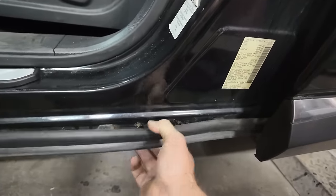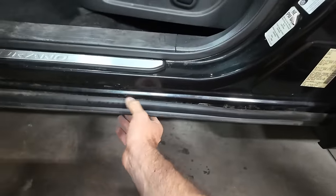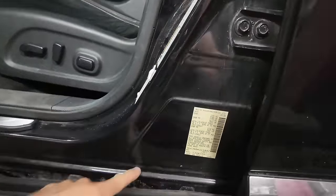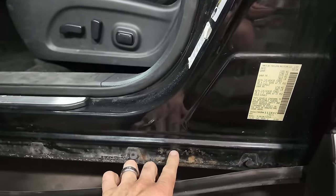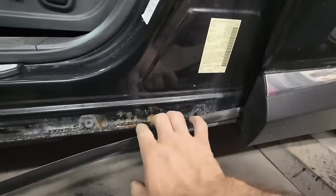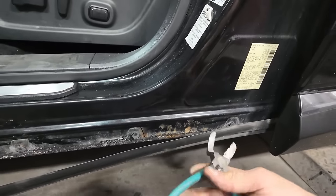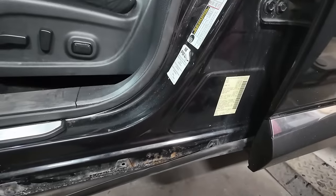Fiberglass strand does not absorb water — it's waterproof and it will actually add a little bit of structure. I think I'm going to go that route instead of welding a piece on here that could possibly just rust again. I'm going to spray a rust inhibitor in here, but I also have to sand it again and grind it with something rough — not just a wire wheel — so that way it sticks. But before we do that, let's see how bad the other side is. Rust is always worse than it looks.